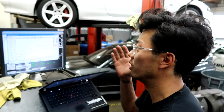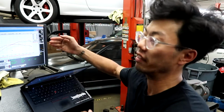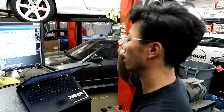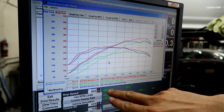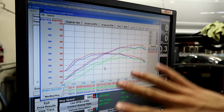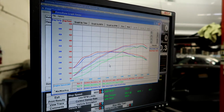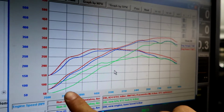Part of going through the various degrees and tuning those, the next step after that is dynoing the full power runs after you've corrected all your AFs and stuff. So I just usually go in. The blue line is where I guesstimated a good cam timing profile, which I'm used to with turbo cars, very similar to a GTR. So blue line's what I did there.